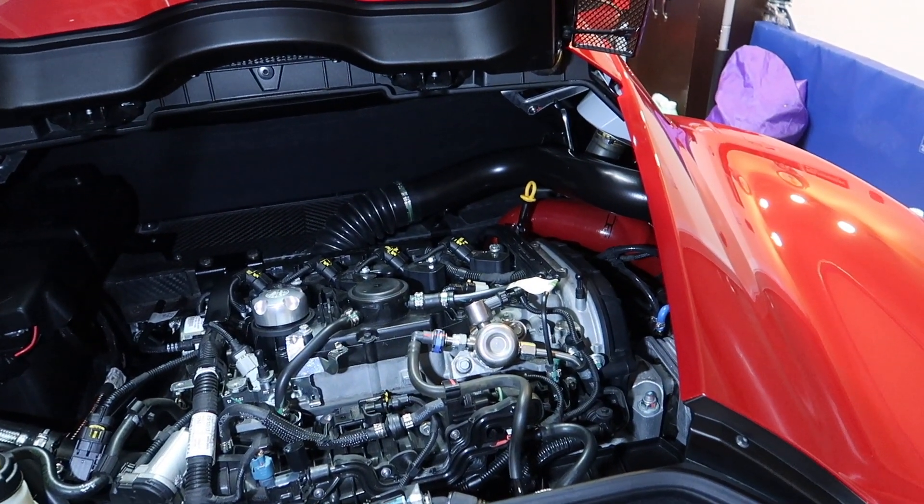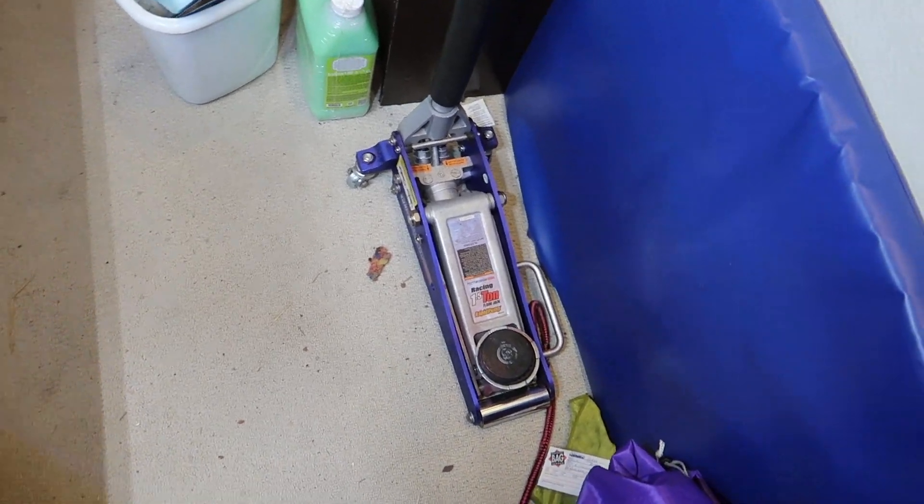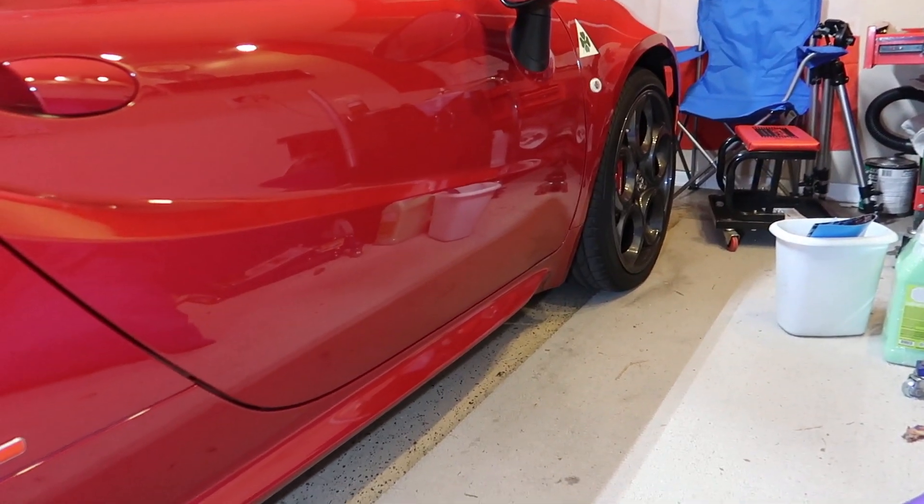This is where I kind of had an issue in the beginning and I was thinking I'd have to get somebody to do it. My jack is fairly short, and to do this correctly I would have to put my jack all the way down there, so it's not going to work. But I was lucky enough to figure out that within my carbon fiber chassis tub, there's a jack point in the middle. I was able to jack it up from the middle and both wheels went up. I wanted to be safe, so I put my other jack underneath there and everything went perfectly.